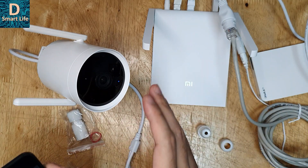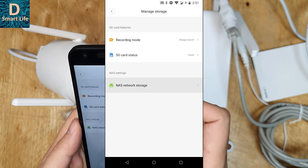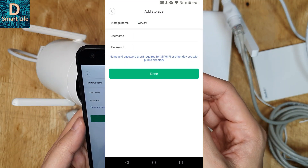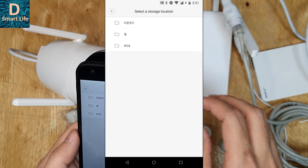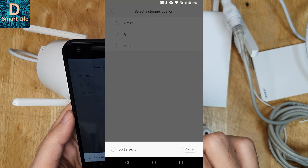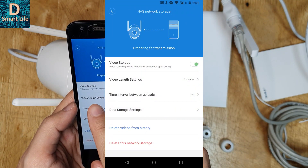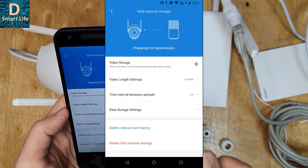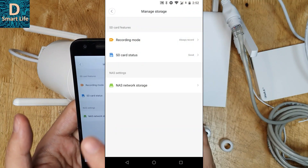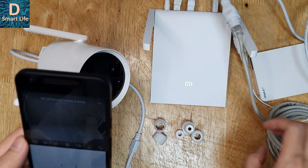Next I'll show you the NAS setup. Since we have the NAS connected and the camera connected, go to Manage Storage and then to NAS Network Storage. It has detected the Xiaomi router NAS, so select it. If you're using a Xiaomi router you don't need a password because it's automatically detected through the app. Select the location where you want to store the videos and the NAS will be set up. The video storage option shows a three-month video length and you can upload live — these are the available options.